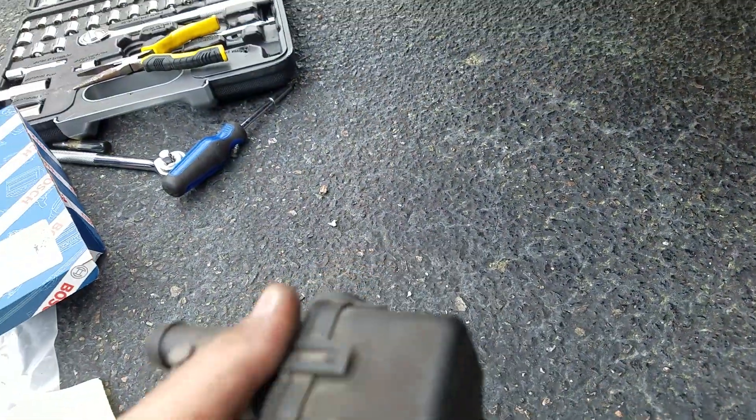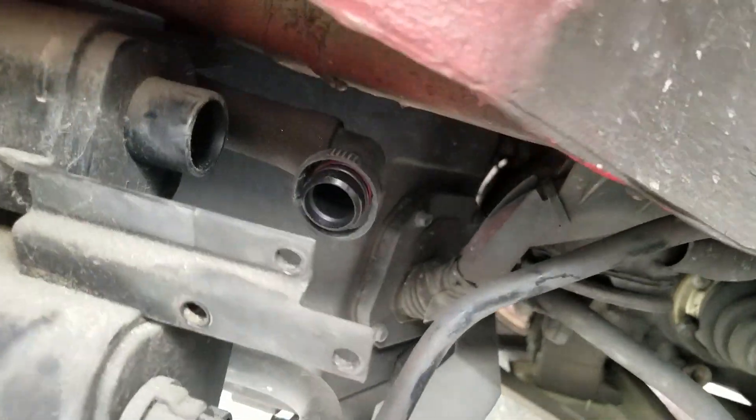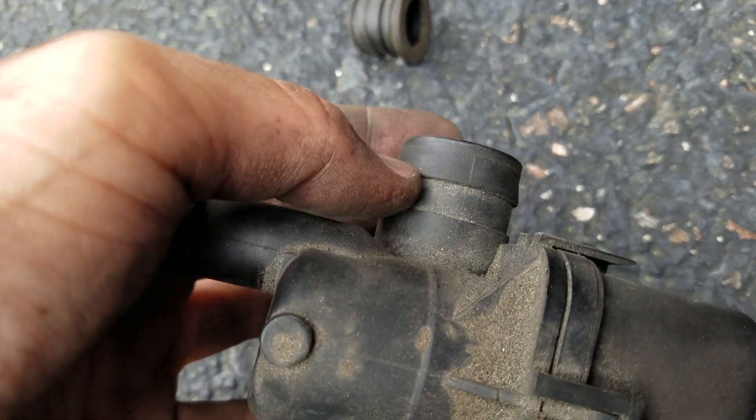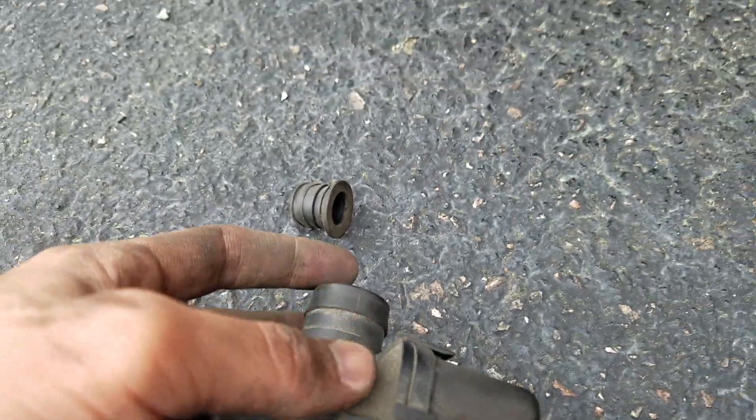On the right half, towards the center of the vehicle, you have this hose right here. All you do is — see the graded sections here and here — you pinch real hard and you pull out. What you're doing when you pinch is you're widening it so you can get over this little bump here.